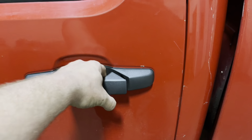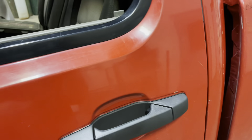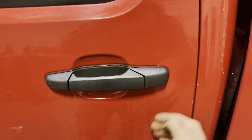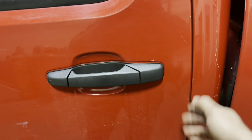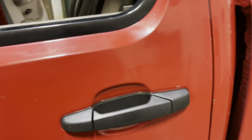Welcome back. This video is for an 07-13 when your door doesn't open. This is the door in question — currently a three-door truck because I replaced the door handle. Even if you unlock it from the inside, it will not open. The lock actuator that does the thing that opens the door, they rust and get gummed up and they don't work anymore. So I've got a new one to put in.